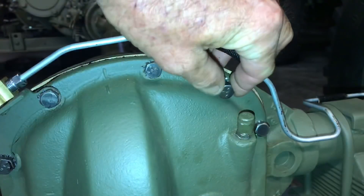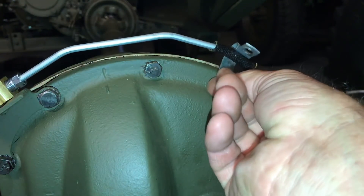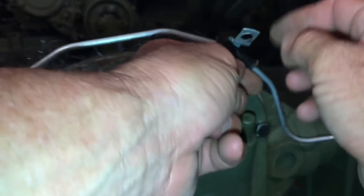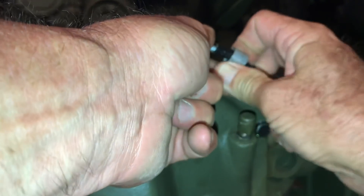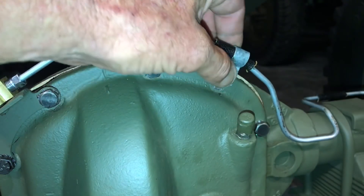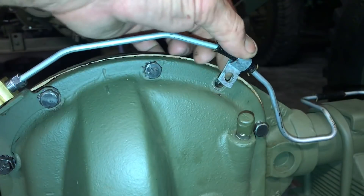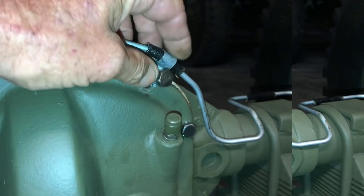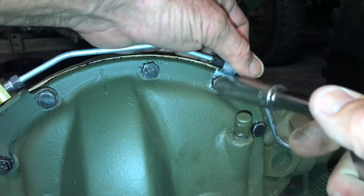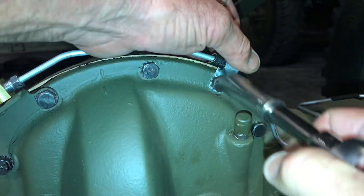Next, install the brake line to the passenger side of the vehicle — you'll notice asphalt-coated loom on these lines, which comes into play later. It's easier to start at the brass T fitting on the differential and work your way out to the wheel cylinders. The clip that holds the line comes with the brake line kit — open it carefully, install it over the loom, then use slip-joint pliers to very lightly crimp it so the bolt hole lines up with the hole on the differential. Install the differential cover bolt with lock washer through the clip, fasten it, and snug it with a ratchet.